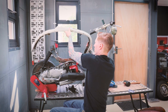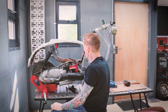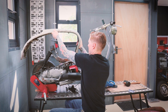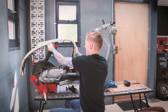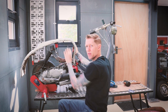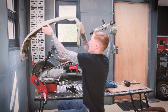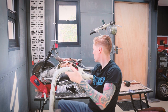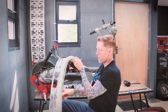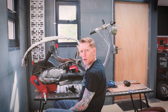It's going to need a lot of work. Normally this loop would fit kind of there, but being a lanky git, my plan is to actually move it back a bit and have it sat lower. We can bring it down a good 50mm before it hits any suspension bits. I'll need to trim the front of the loop and I reckon we've got another 50mm there. So I'm going to bring it down about 50mm and then push it back probably another 100mm, just so the seating position is a bit nicer. Quite like the look of it sitting out past the back wheel, a bit like an old American car.